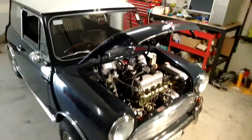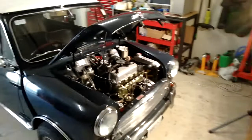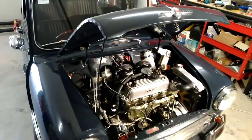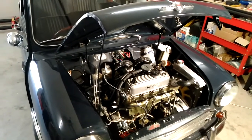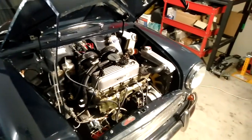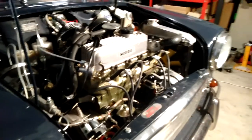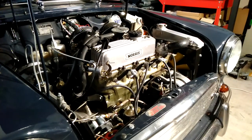I've taken it out for a run — about five kilometers — and it's running okay. I'm noticing now that the valve tappet rockers are tapping a bit, so that's the next thing I'll need to get sorted. Now I want to take off the high tension leads, take out the spark plugs, connect up the gauge again, and see what the compression is now that the engine is warm.